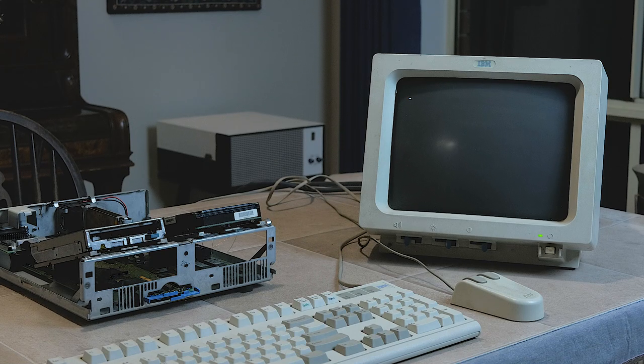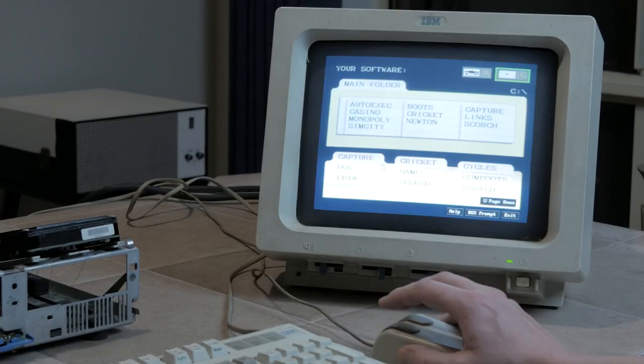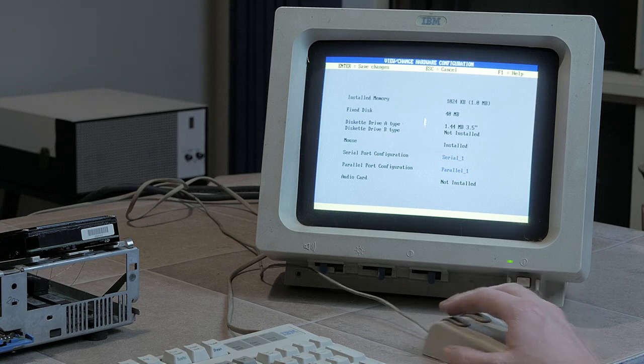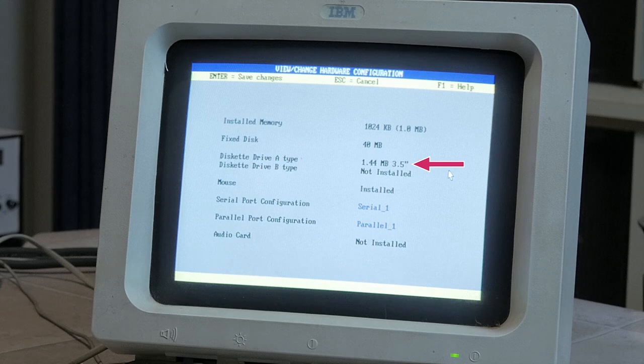It's a good sign that we don't see any magic smoke, at least. So far so good. I've still got a keyboard error to sort out another day, but we can see the PS1 boots into the 4 quad screen as usual. So let's go to a DOS prompt and see if the machine can detect the floppy drive now. I run the configure command, and things start to look promising. Floppy drive A has now been detected, and it is showing as a 1.44MB 3.5-inch drive, which is correct. So hopefully now we might be able to access it.